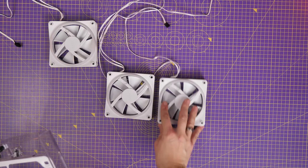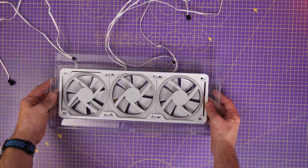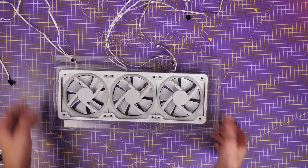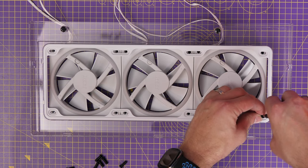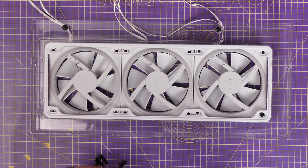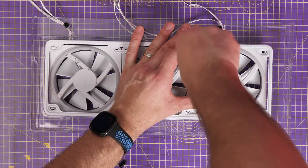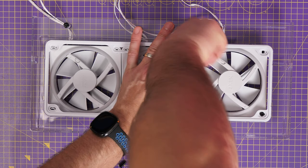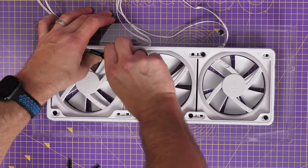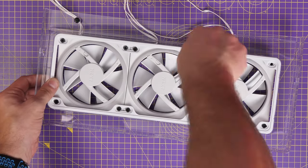For the top I'm using 120mm fans again, mounted face down into the case — screwing the fan screws in from above. Use either the screws included with the case or those in the fan box. Four screws each, face down into the case. This pulls the hot air out — the CPU, RAM, motherboard and GPU are all producing heat that we need to exhaust to keep things cool. You could alternatively top mount the radiator here, setting those top fans to pull air through the radiator.